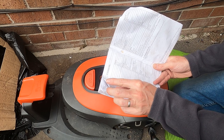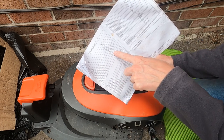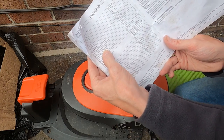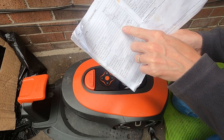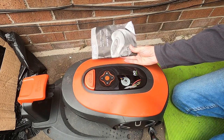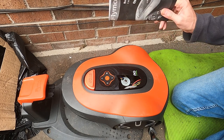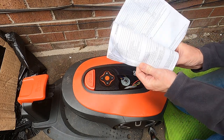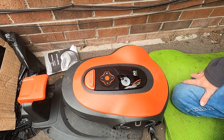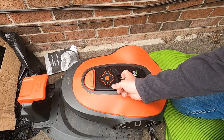Having the manual is quite useful. In the back it has the specifications: battery, power supply, cable, and charge current. We know the power supply is 28 volts DC and the charge current is one amp. Looking at official Flymo chargers, you can pay £100–£150, which is a lot for a power supply. Instead I looked for a 28-volt, couple-of-amps power supply and found one used for reclining chairs — I'll just replace the connector on it and power this up. That might be a good option if you've lost a charger.